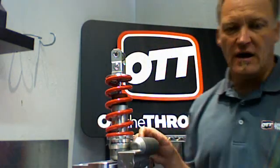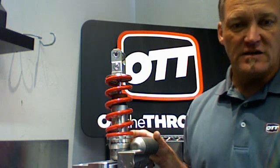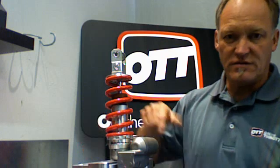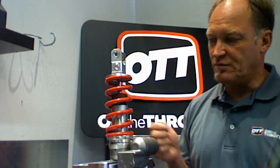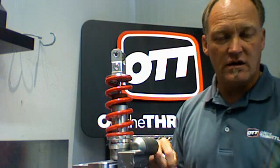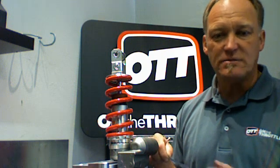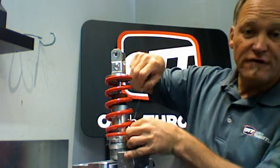The R6 shock has a ramp adjust for preload where it's notched — eight notches available on the bottom. There's a castle nut here which allows you to grab it and turn it to a preload setting. When a spring is put on the shock, you're looking for a difference in length. You can't have a spring that flops around, so it has to be compressed a certain amount to be firmly held in place.